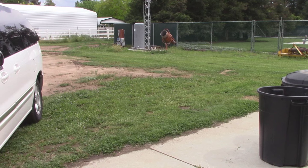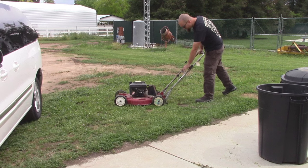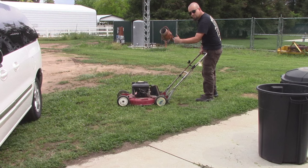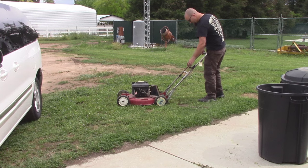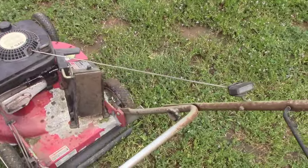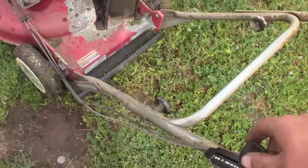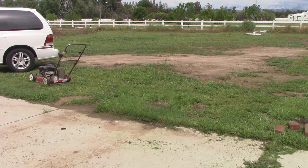I'm going to go ahead and throw this thing back on and update you guys with the linkages. I'm definitely happy with that — thing runs pretty good. The only thing is you don't want to move it to the slower speed really fast or else, as you guys heard, it starts to die out. Start it on choke and then bring it back to full speed and it runs pretty much as it should. This whole area right here is pretty grassy, so we'll go ahead and start mowing this.